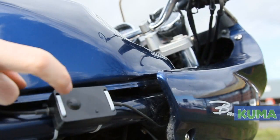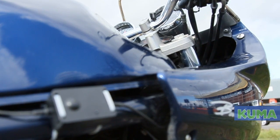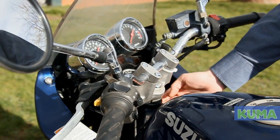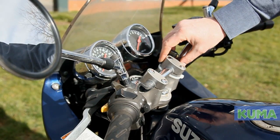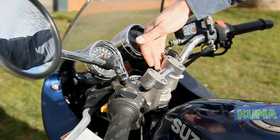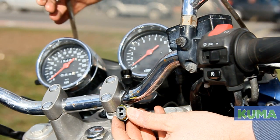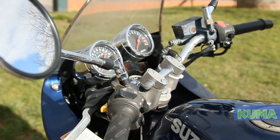The switch box is secured with cable ties, allowing easy access with a gloved hand. Run the cable along the frame tube, securing with a cable tie if required, and follow the lines of the brake and accelerator cables up under the handlebars and onto the top, where it is secured by a cable tie. This allows easy access to the socket and its waterproof cover when riding along.